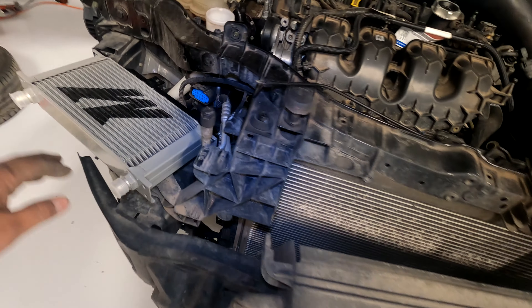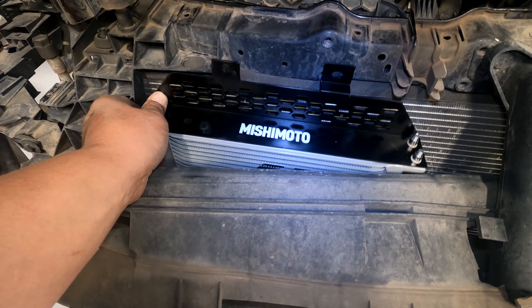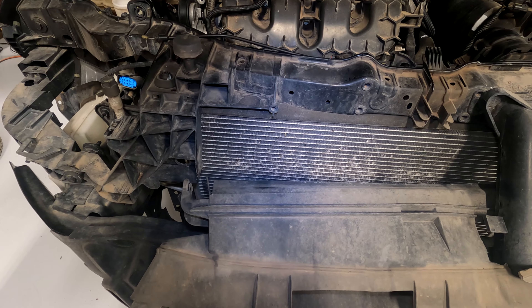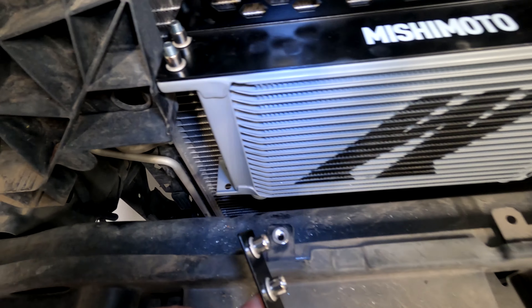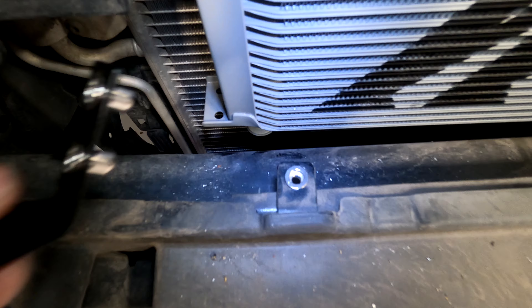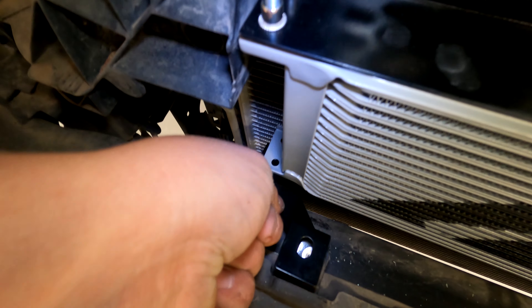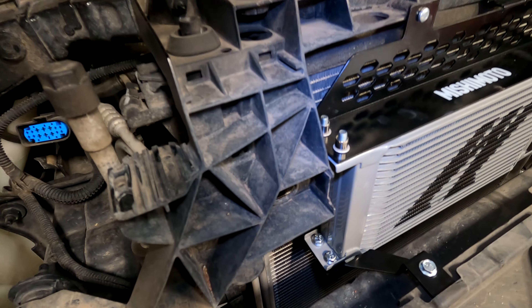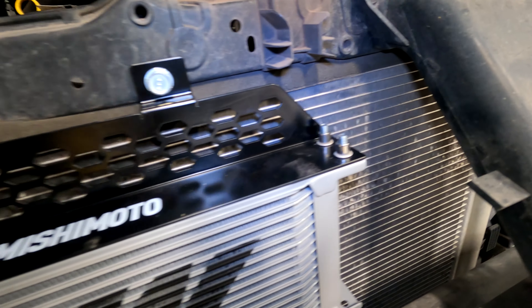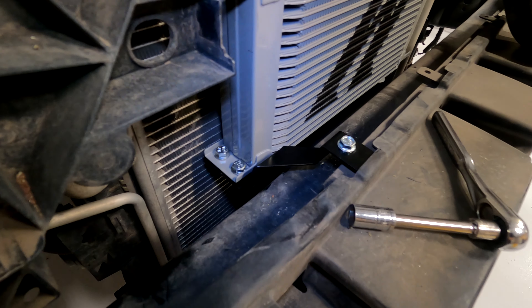This core is going to mount — it's more or less going to fit like this. I'm going to go ahead and mock up and mount the top two screws. I love this new tool of mine. I put inserts in this bracket and then insert into this tab on the body, so this will fit in where this piece goes under the cooler and then on top of this hole. This is my install — I think it's a lot cleaner. You can use the hardware they give you, but if you have the means to buy one of those nutsert installers, I say do it because this is nice.